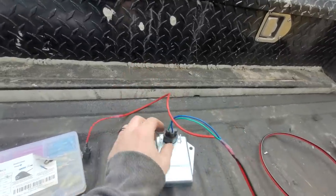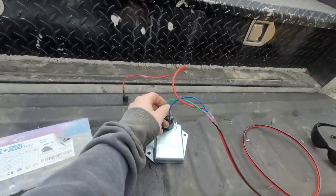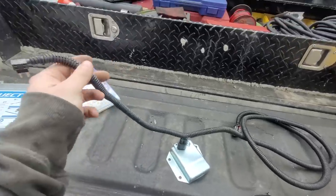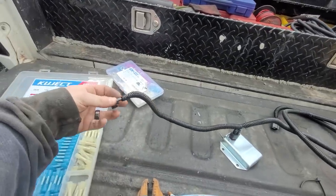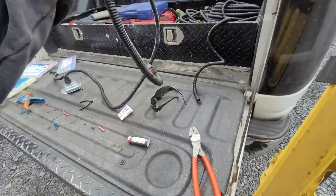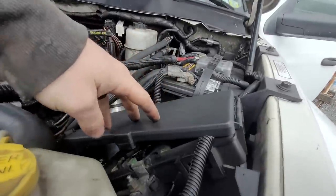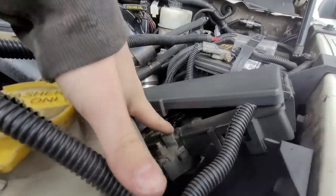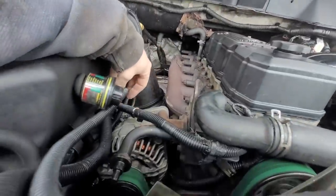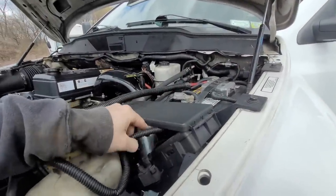For you guys wondering about the diagram: the middle is switched power to the positive of the alternator, the green here is negative and goes to the other side of the alternator, and this gets grounded through the case. So this goes into the fuse box, this sits on the firewall, and this nice harness will come and plug right into the alternator. I'm going to feed this nicely into the side of the box and run it all the way along and plug into the alternator. It'll look just like a factory loom, only better.